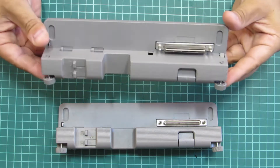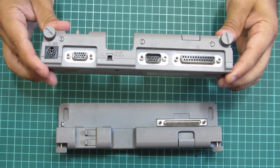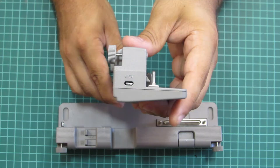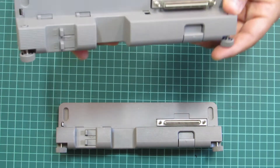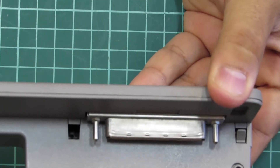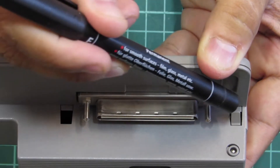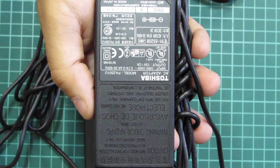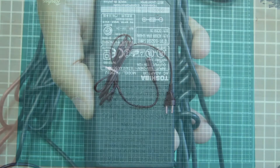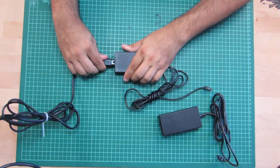The two Librettos also came with one port replicator each. These offer the sought-after connectivity options: a PS/2 and VGA port, plus RS-232 DB9 and a parallel port connector. There's also a mounting hole for a Kensington lock. With one of the docks, I hear clicking from the inside — seems like there are some broken-off clips. In the close-up we can clearly see that one of the two push-out clips is broken away. Here are the two power supplies I bought off eBay. These came from the United States, so I needed to replace the cables with standard Europlug cables. When applying power, I'm overly happy that no fuse blew.